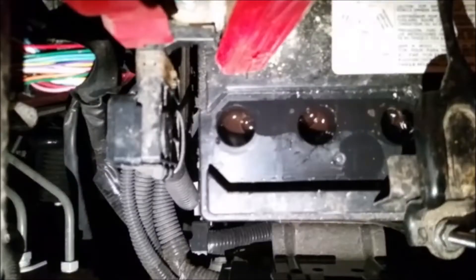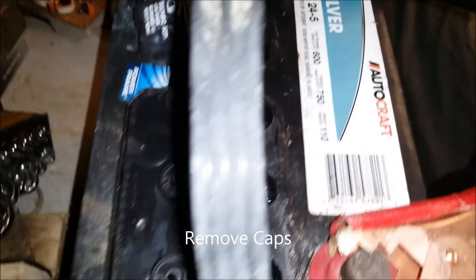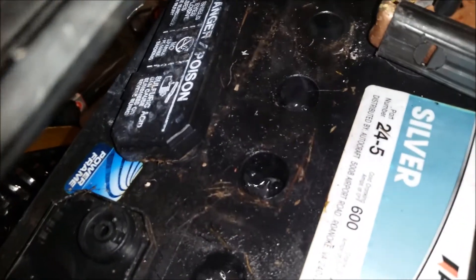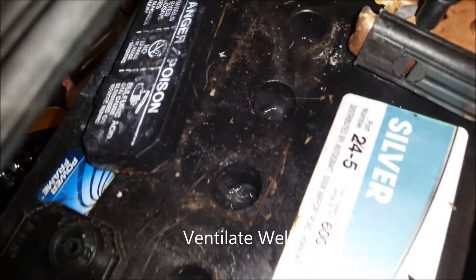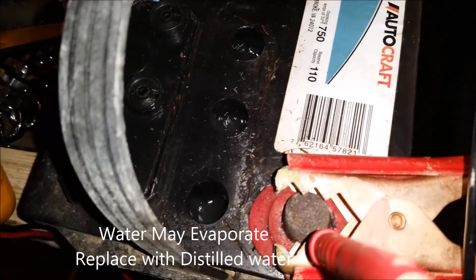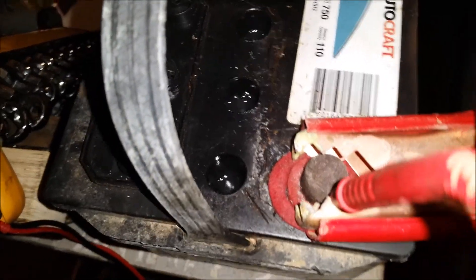What you want to do to be successful for this kind of operation is disconnect the battery cable from the battery itself, in case anything causes the voltage to go above the car's system voltage. It's probably better just to pull the battery out of the car altogether. Make sure to be cautious — get some safety goggles and work with those on. There shouldn't be any major splashing, just some minor bubbling. There is a release of gas, so make sure your area is ventilated — it's better to do this outside, or if you have a garage, make sure the garage door is open.